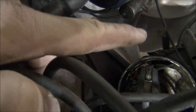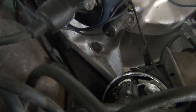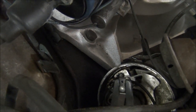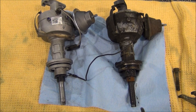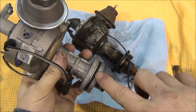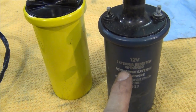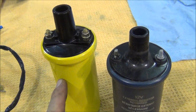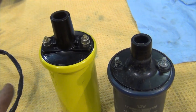Don't forget to disconnect the battery cable. Notice how the ignition rotor is pointed just before the clip, basically pointed right at the bolt for the condenser mounted to the side of the coil — make sure when the new distributor goes in, it's in that same orientation. Also, distributors are really hot when you take them out right after driving. Make sure your distributor has an O-ring because sometimes remanufactured ones ship without one. Since we're getting rid of the external resistor, we need to make sure the coil is internally resisted — this off-the-shelf brand is internally resistant.